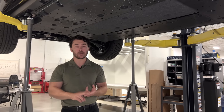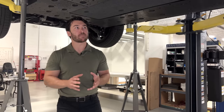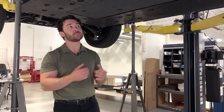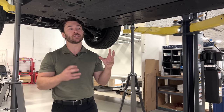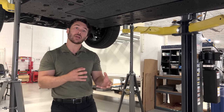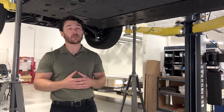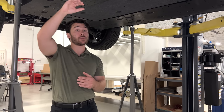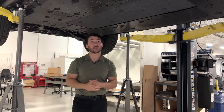We've seen Mach-E, Lightning, EV6, IONIQ 5. Lots of packs use extrusions for their body or for the overall structure. This is the first time we've seen it leveraged to capture more than just physical structure in those extrusion profiles, but rather using those for a functional purpose as well, in terms of delivering glycol both to the battery modules on the inside as well as to the drive units at the rear of the vehicle.